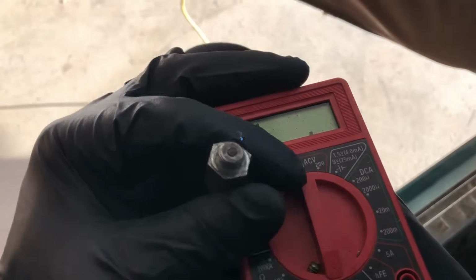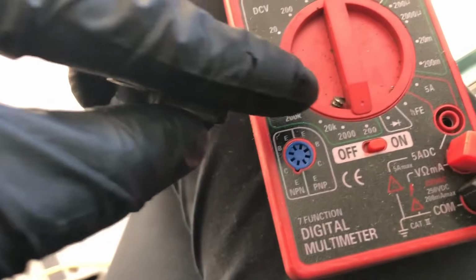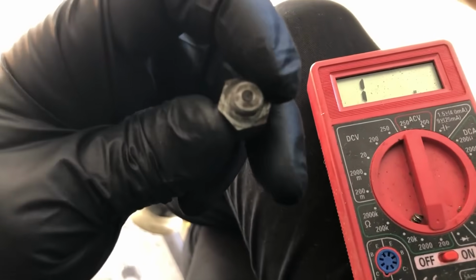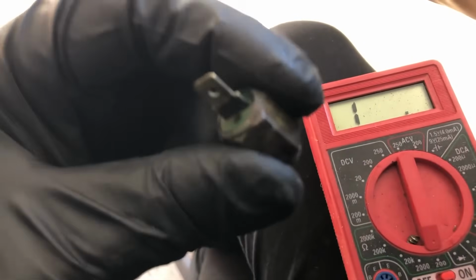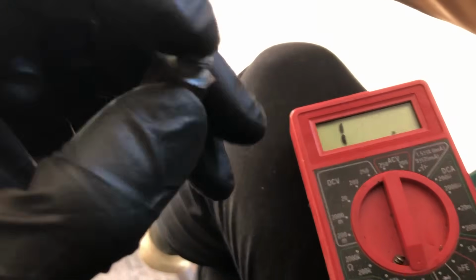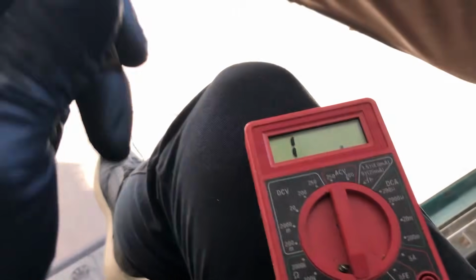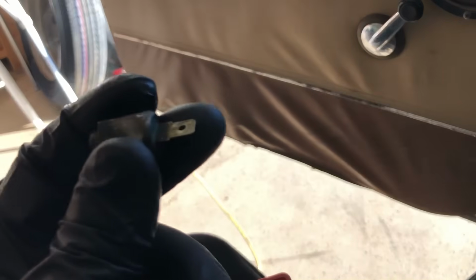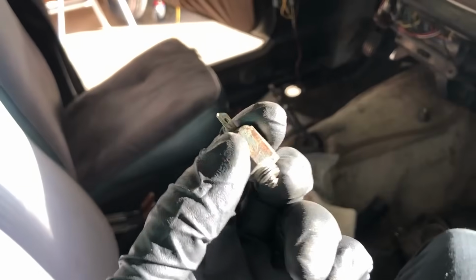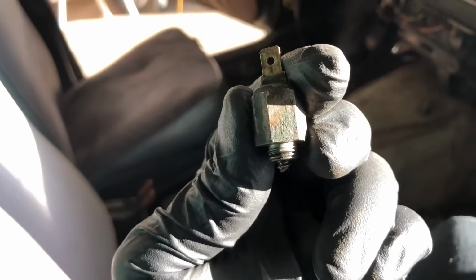I'm fairly certain that I've figured out exactly what is going on here. Somebody has screwed in a portion of a screw in the switch to remain constantly open. That way the switch is not illuminating the brake light constantly. So this brake light in the middle will be illuminated by one of 2 things: if this switch is failing, or if the parking brake is on. So I guess instead of just unplugging the darn thing, this switch has been screwed, literally.